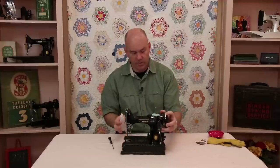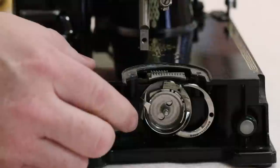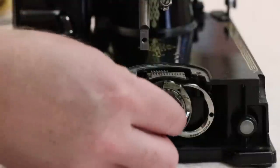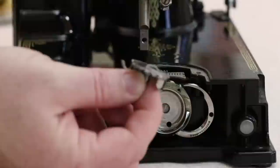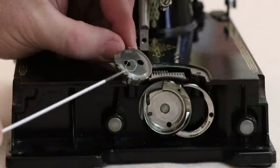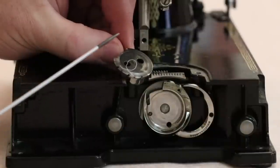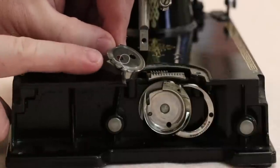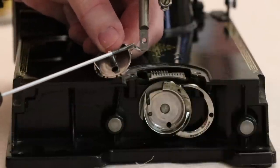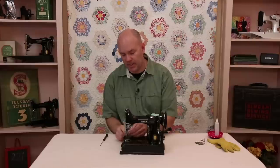This one has already had oil soaked on it, so we're going to spin the gib open. Turn the bobbin case base to where the positioning finger is straight across from the hole, then pull it right out. You can see that piece of thread back there had this machine completely locked up — just a little piece like that, often even smaller, will completely lock up your Featherweight. It's important to note that if you try to force this while it's in the machine, the positioning finger often gets broken off, which is an extremely costly repair — so there's no need to force it.